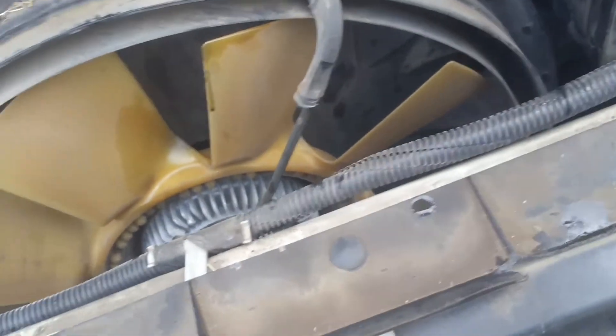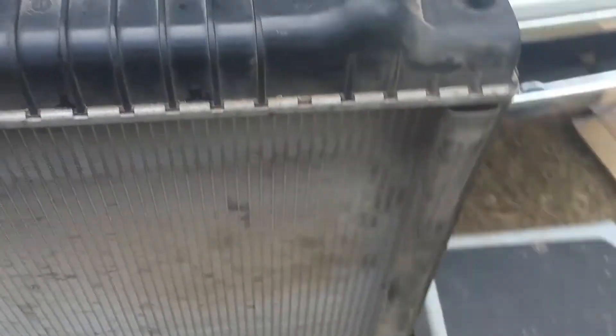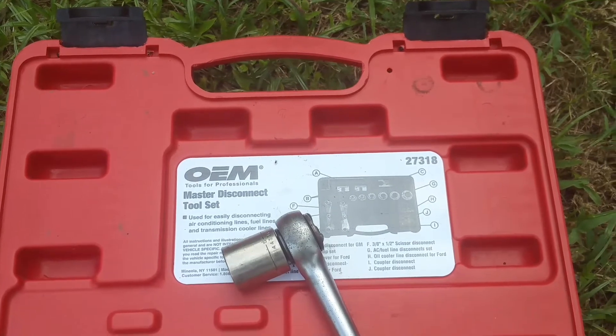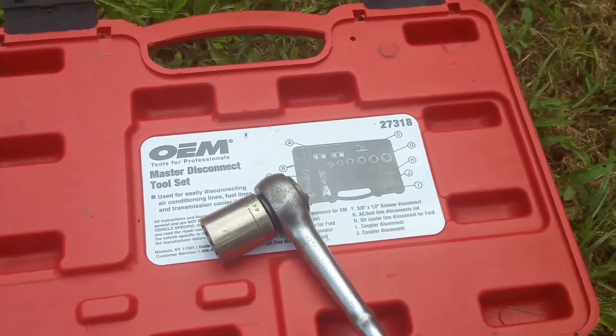The bottom lip of this shroud just wants to hang up on that fan. So putting it back in, I will definitely go back in with it on there — it just takes a little less risk of scratching up the fins and dinging them up on the radiator. But that's everything as far as getting it out of there. Not really that difficult. You're going to need a tool, and like I said, you can go to AutoZone and rent this. This one little tool here will in fact work — you can see how it's kind of stepped up there. Just push it in there and it pops it out.